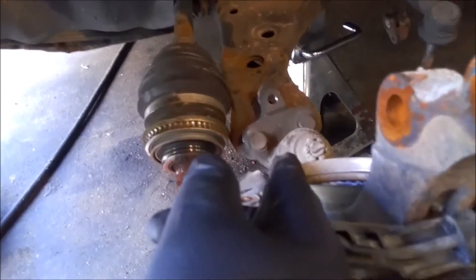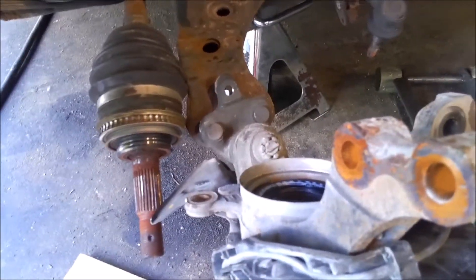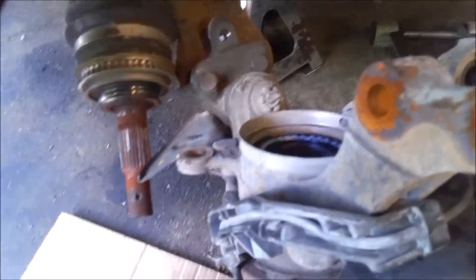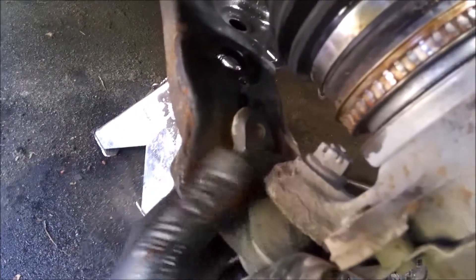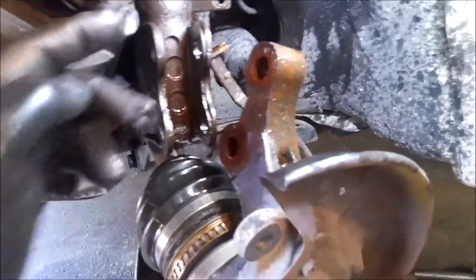What we're going to do now is just set this up onto the lower ball joint and strut and start bolting it back together. I got the two nuts and the one bolt for the lower ball joint — 17 mil — we'll just pop those back in real quick. That'll attach this hub to the lower control arm. Then we'll slide the axle in and put the strut bolts in. These three will go in next, then we'll slide the axle in — put a little lube on it and slide the axle in. Get the bottom ball joint in, slide your axle in to the hub, and then we'll push it up against the strut and put those bolts in.